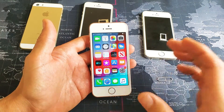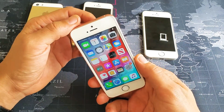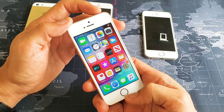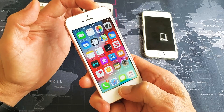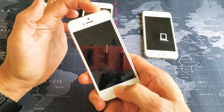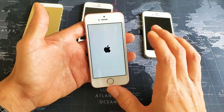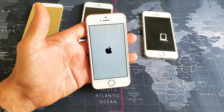The next thing is we're going to force the iPhone SE to restart — it's called a force restart. It's a two-key combo: press and hold the power button and the home button at the same time. Press and hold both buttons — do not let go. Just keep holding until you see the Apple logo appear, then you can let go. Wait for the phone to boot back up, give it a minute, and hopefully it finds your SIM card and you're up and running.